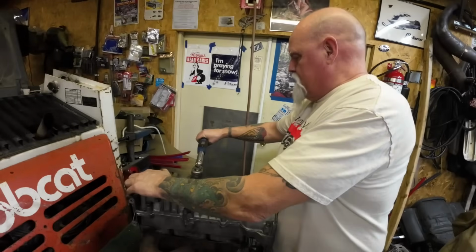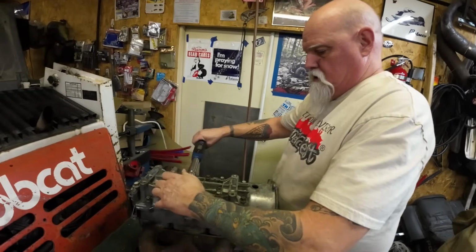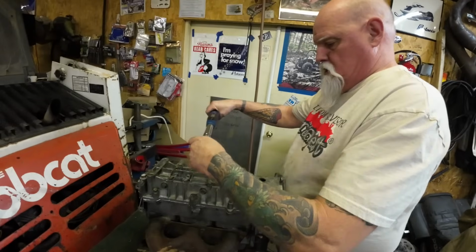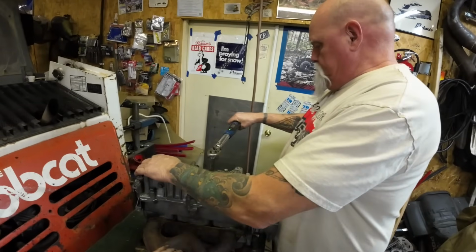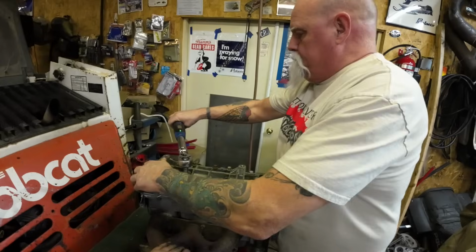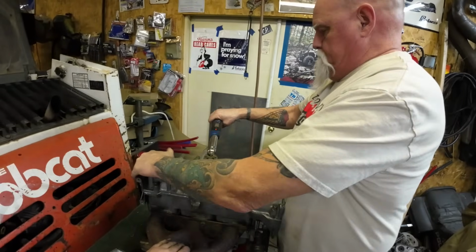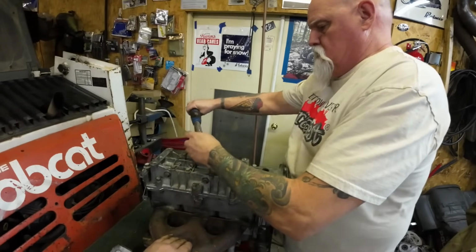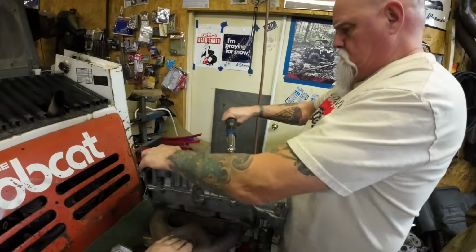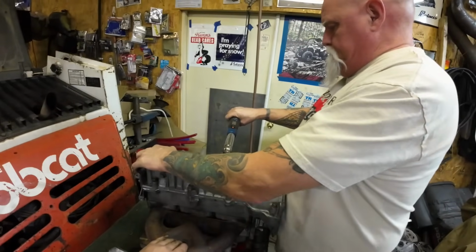All right, here, go ahead, Lon. All right, we're torquing her down. This is our final torques. Lonnie is warmed up already by snugging them down to, I don't know, probably 10, 12. Now we're going to 18 on the smaller bolts and 25 on the bigger bolts. And this is it. Work the pattern, do the job. We'll bring you back when we're done.